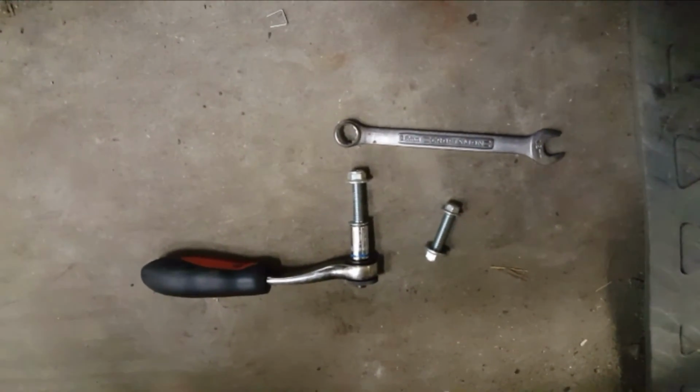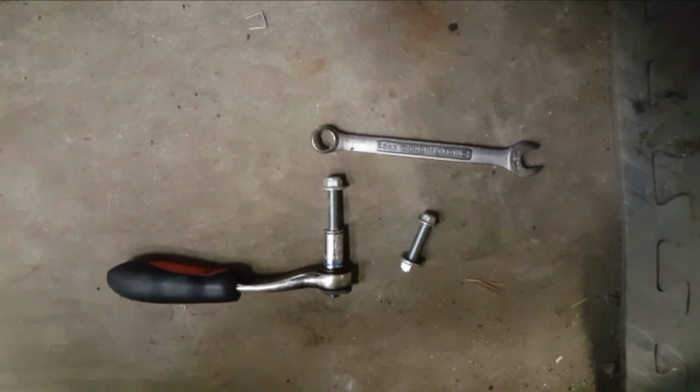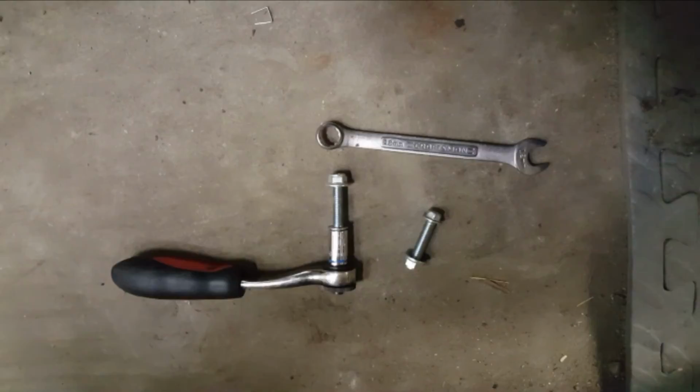Oh, note to self. It appears there's a note on the back side. Yep, right up here. Anywhere without a wrench. Alright. The bolts on the seat are a 10mm socket on the outside and a 12mm wrench on the underside of the fender. Now I have those off.